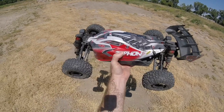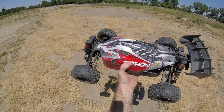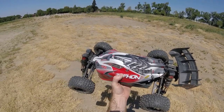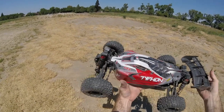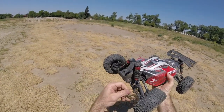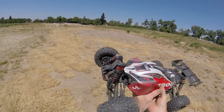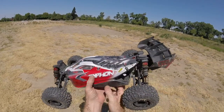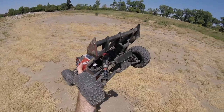Again, I've got it geared up from a 15 to a 20 tooth. I've got a Robinson Racing 0.8 mod or 32 pitch gear in there. So, but yeah, this thing's a little beast. These Turnigy TrackStar shocks are killer value. I'm not sure if they're back in stock, but they're like $15 a set. And again, they're 4mm, 7075 aluminum. The rears are definitely quite a bit longer than the stock ones, as I mentioned in a previous video.